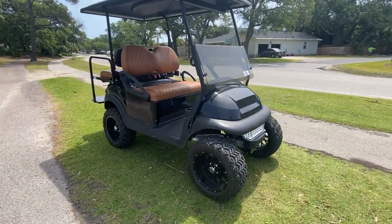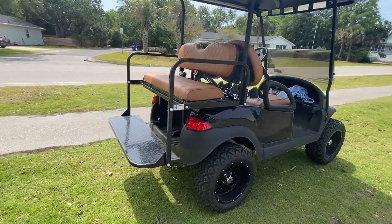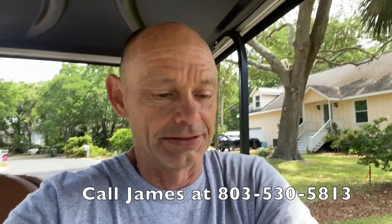I'm going to do some more test driving, then call my customer and tell him he's ready to go. It's a beautiful cart — did this one about a year ago and he does a real good job taking care of it. Other than just a little bit of yearly preventative maintenance, these carts should get you 20 to 30 years worth of life. That's a wrap for front end alignment on a Club Car Precedent. Pretty simple — you do a lot of them and you end up getting an idea of how much you need to turn, but there's a little trial and error to begin with. I appreciate you guys tuning into my channel — please click and subscribe. I like to put out golf cart tips that your ordinary Joe can do. If you're interested in a lithium battery or Plumquick motor, I try to keep those in stock — I cycle them about every 30 days. Most of the time I have them in stock for the Club Car Precedent. Appreciate you tuning in, hit me up if I can help, and you guys have a great one.